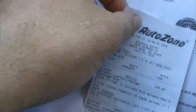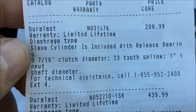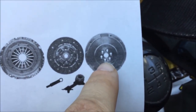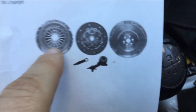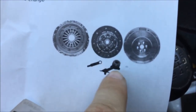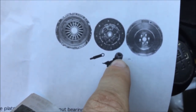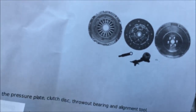I don't think I want the flywheel — I'll do a little research on that. The way it sounds is if you really wrench on your gears, which I never do, then the flywheel should survive. It's the plate closest to the driver. I'll just replace the pressure plate and disc inside the bell housing. Of course, the real problem is this throwout bearing, or the slave cylinder, that's leaking.